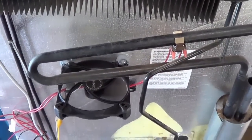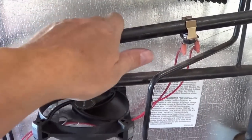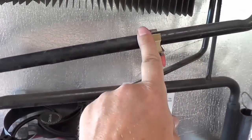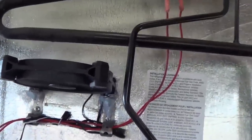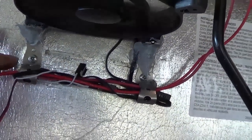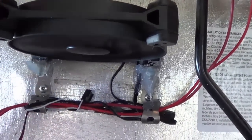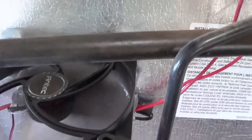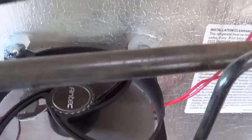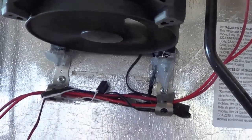I've mounted the new fan and moved the thermostat over here so the fan's not blowing right on it. It's also in one of the hottest parts of the pipes, so it'll turn the fan on earliest. For mounting I used the same holes they had used, with some pipe hanger material doubled up — it's got a little flex but not too much. I ran wires along the bottom of the pipes and gooped the nuts and bolts with silicone. Once that dries it gives extra support and keeps the nuts from backing off due to vibration while traveling.